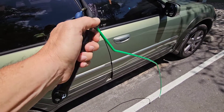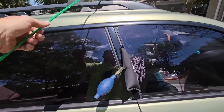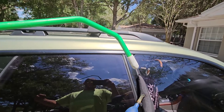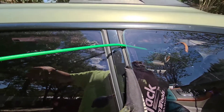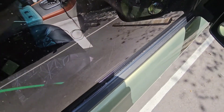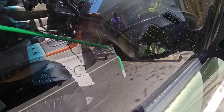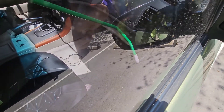You can get this by calling Access Tools or going on their website. If you're doing this yourself at home, you can bend up a couple of coat hangers — just make sure you tape up the end really well so it doesn't damage anything inside. Or you can buy a quarter-inch metal rod at Home Depot. Feed it in through the door frame, come over to the flipper lock, hook it, and flip it — I think it's forward on this one, so just get your tool behind it and nudge it forward.